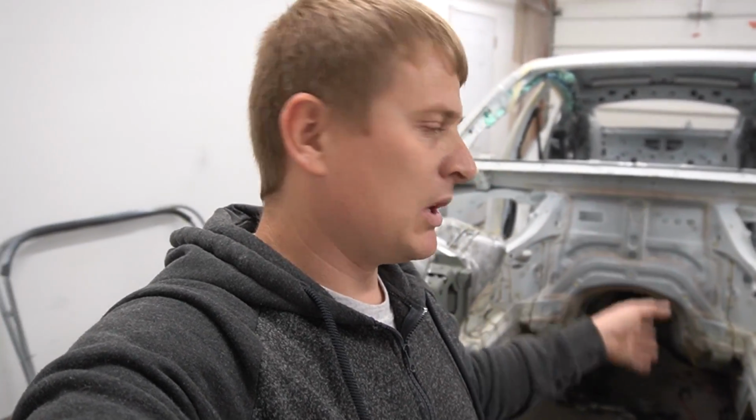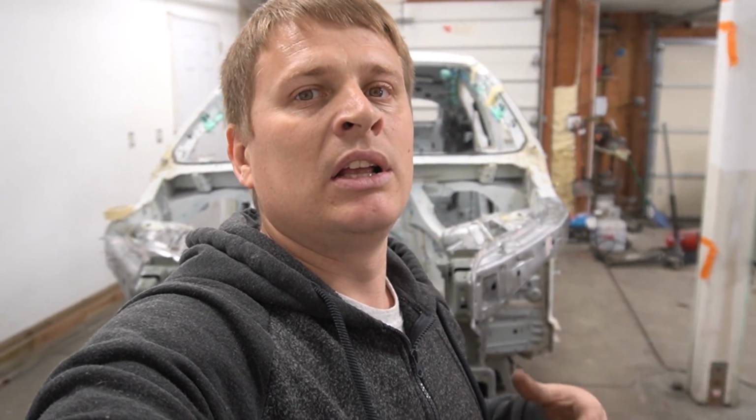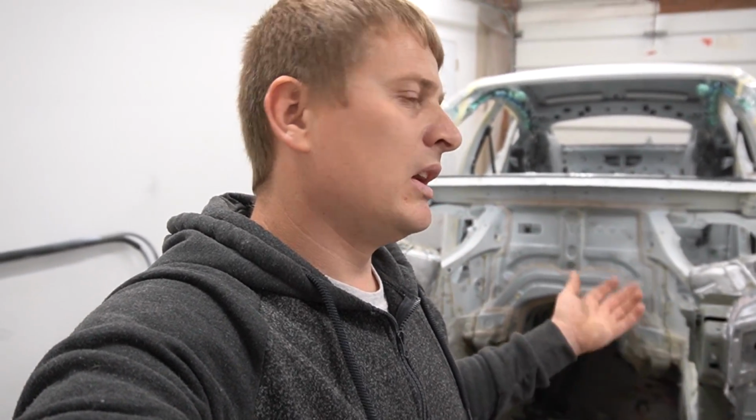Before I'm gonna start painting, I'm gonna apply the self-etch primer on the front end where the metal is exposed. Then while I'm gonna be mixing the sealer, it's gonna dry enough to apply a sealer. And as usual, after a sealer base coat and a clear coat for the front end, but for the roof, I'm gonna have to apply 2 coats of the pearl, so the roof matches with everything.